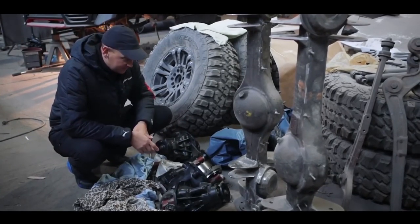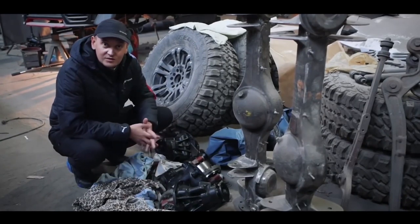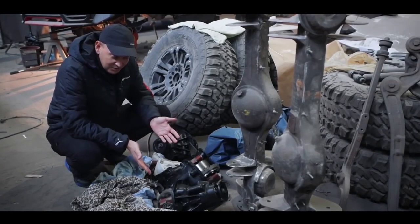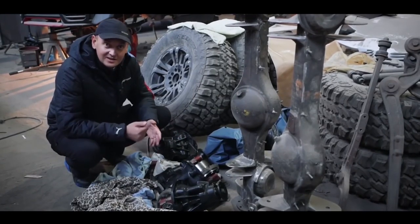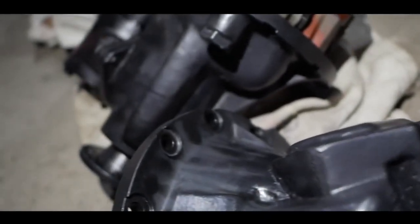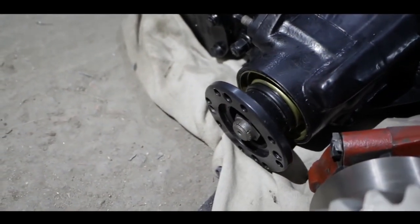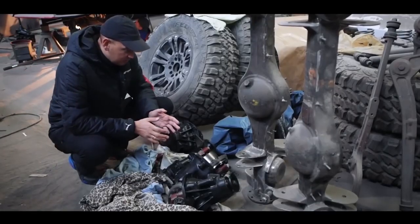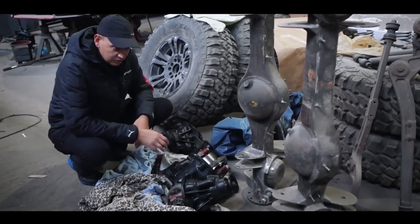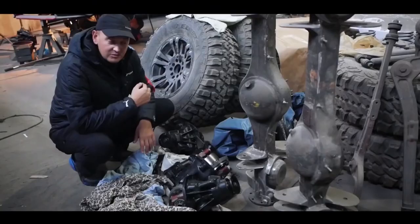The only minus is that we need to take a chamfer off the main pair because they didn't fit properly. I don't understand how the producer could let it happen, but it is not a problem. We took it to the tuner and he solved this problem in half an hour. It was half a millimeter and they fit properly. Then the reduction gears are fully washed and prepared. Oil seals are all new in stock. We are going to wrap the crankcases due to dust and start the final assembly.